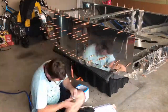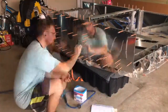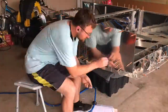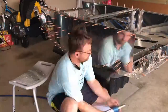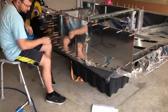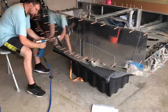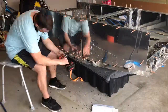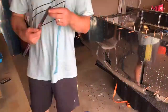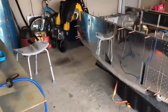And as per the instructions, you have to start with the cherry rivets. I'm putting in the cherry rivets and then start with the typical LP4-3s. And then moving backwards, there are several holes that you're not supposed to rivet, so pay attention to the plans here. Even on that doubler and tripler plate, there are several holes that you have to skip over. And then it's just going around and finishing all the rest all the way up to the front of the fuselage and the front of the longerons as well. Not all the longeron holes get riveted in right now because you have to install the skins that go over the baggage compartment later on.